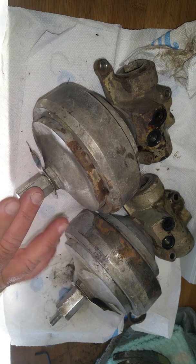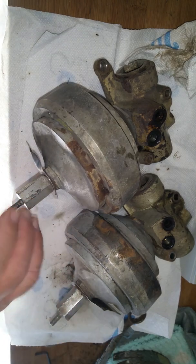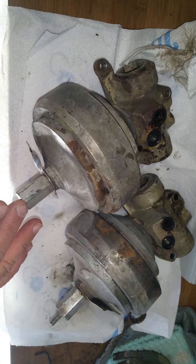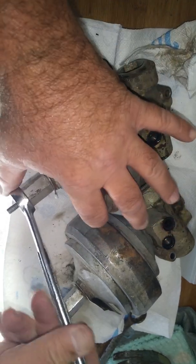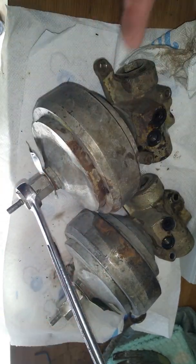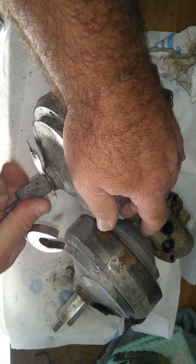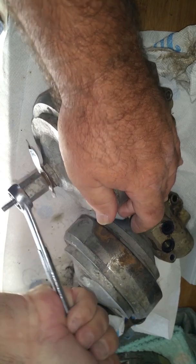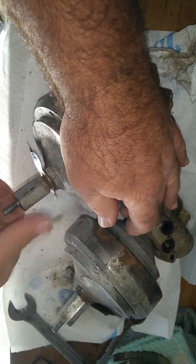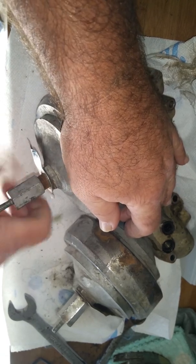What we're going to do is go ahead and unscrew these. These are the cap plates that cover the valve of the sphere where you would charge it up to 1,000 PSI. I already loosened them up a little bit. We put them in a vise wrapped up with a rag, and we're going to take these covers off. You can see they just basically unscrew, and that takes a three-quarter inch wrench right there.